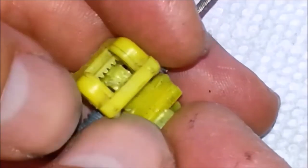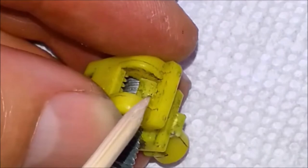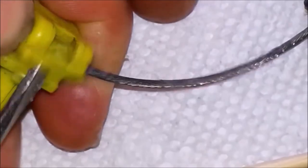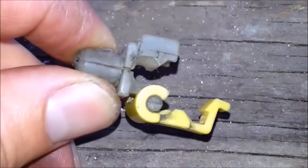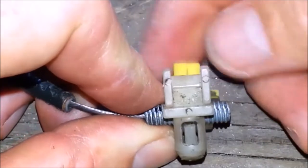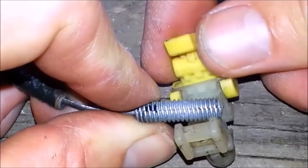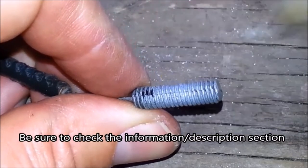If your cable has a yellow clip on the end, you probably won't need to remove the clip, but just in case you do, it's nice to know how they're put together so you aren't as likely to break them. If your clip looks like this, there's a tab that snaps under a lip — you have to push something about a sixteenth of an inch or more thick under the lip to force the tab out beyond it. If your clip looks like the other type, you can probably open it with your thumb, or put a small screwdriver in the slot and twist. To put the clip back on, just snap it around the threaded end of the cable. If you break a clip, you can find replacements in most chain auto parts stores.